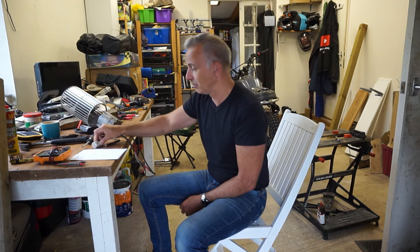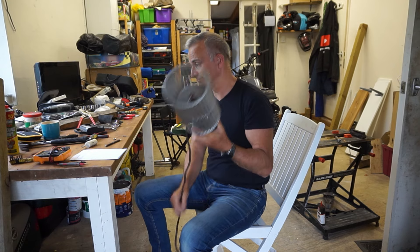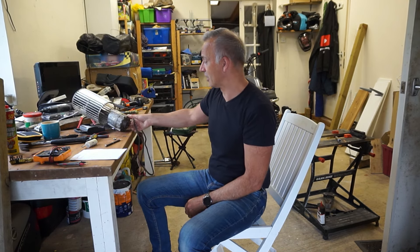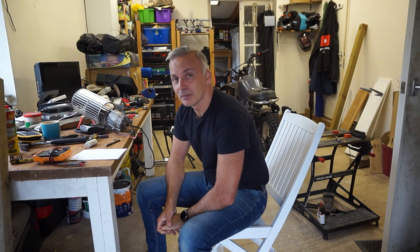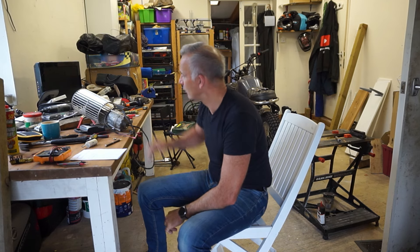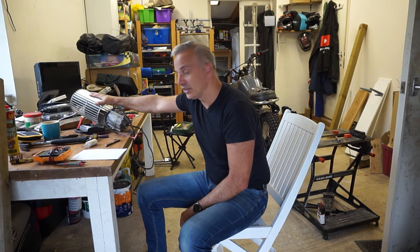That was the capacitor that appeared to test okay but I thought might have been the problem. I've purchased and fitted a new capacitor of the same specification - it seemed to go straight on, the markings look near identical - but it made no difference. If the motor doesn't turn, all my efforts on the dehumidifier are of no benefit. I got as far as I could stripping the motor but I could not get any further with the fan on, and the fan is seized solid and rusted in place.